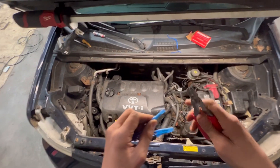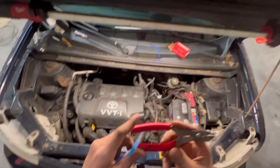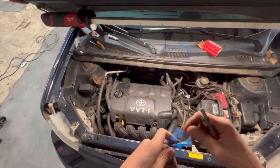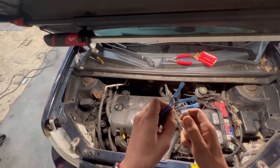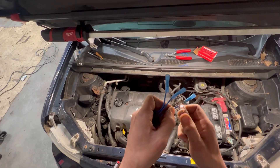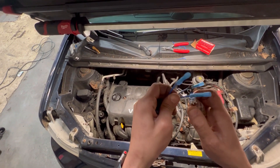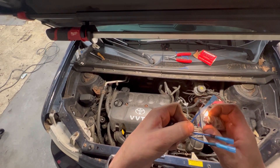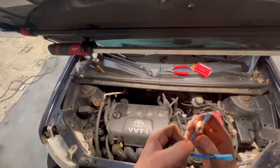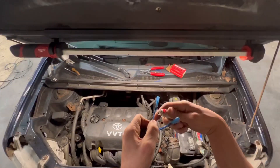This is where some good crimping tools come in handy — I'll try to find a link in the description. Now, I see a lot of people when they do electrical work, they never heat shrink the connections. It's very important to heat shrink because moisture won't get in and corrode the wires. We're going to do that on this end, then again down at the car. You can do it with a lighter or a heat gun — I just like the lighter. I wasn't giving it direct flame; I was waving it nice and easy over it.